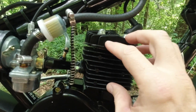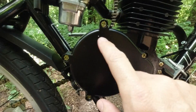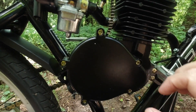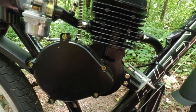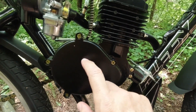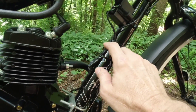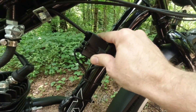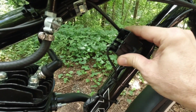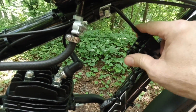The fuel and air go into the single cylinder, and the power turns a gear here, which turns a gear here, which is all part of your clutch. There's no starter and no battery — it generates its own spark through a magneto inside the engine. That goes up into a little power module. In the process of building mine, I broke the connector, but this whole assembly was $8 — again, so cheap. That sends the spark up through here to your spark plug, which makes the spark.